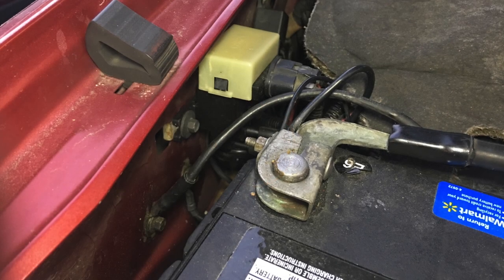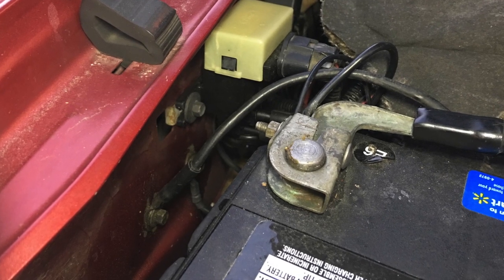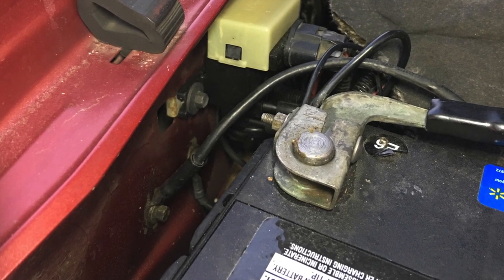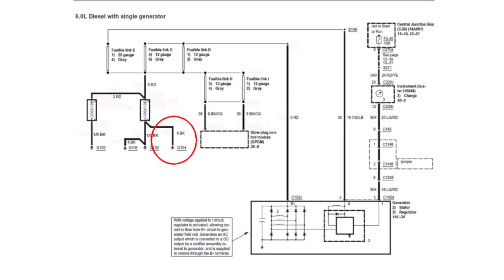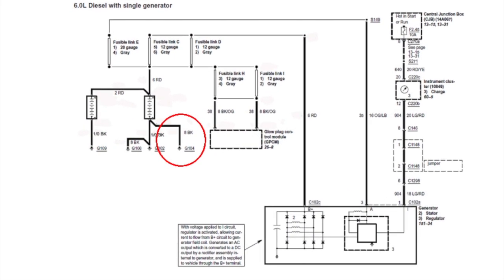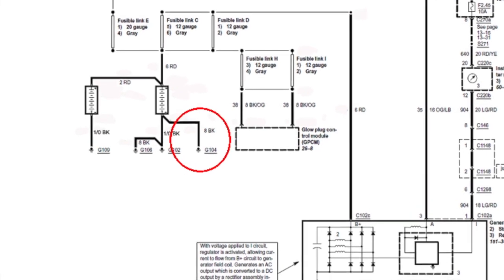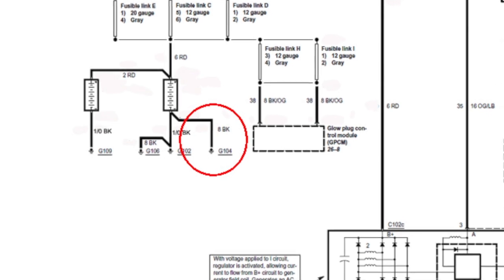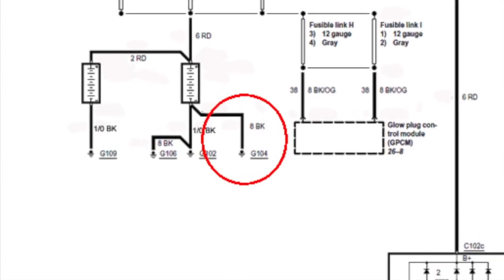There is one noted negative or ground connection to the body tub from the supply of the batteries and the alternator — located from the passenger battery negative terminal to the inner fender, utilizing an 8-gauge cable. Throughout all the pages in the wiring diagrams, this is the only connection from the battery's negative terminal to the body tub. And by means of the battery negative cables to the motor, this is the pathway for the alternator negative side.